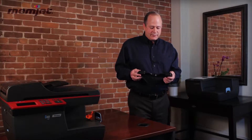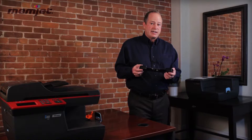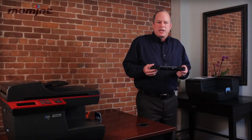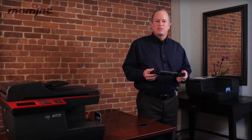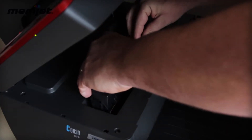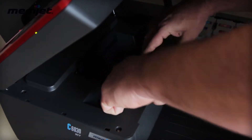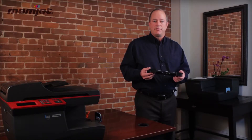From a DPI perspective, the printhead has 1600 by 800 DPI at 60 pages per minute. The life of the printhead is 50,000 pages. At an average monthly page volume of 2,000 pages per month, the printhead will last about two years or so. The printhead is customer replaceable and quite easy, and when you replace it you're basically refreshing the whole imaging system of the printer.